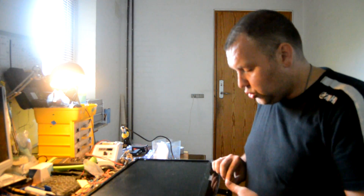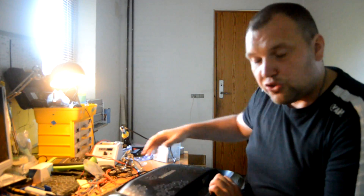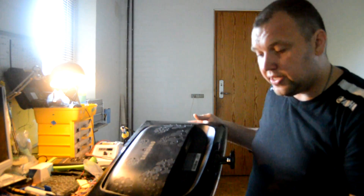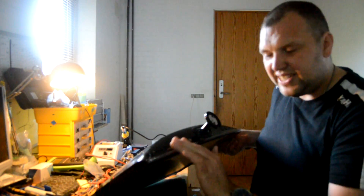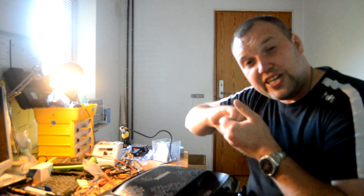I've got the monitor into my work area and I'm ready to disassemble it. The only thing I've done off camera is removing the foot — it had a screw at the bottom you could just take off. It can be quite difficult to disassemble these screens because they don't have any screws on the back — there are one here and one here but that's only for this bezel right there. These are assembled by pressure and you have to sort of wiggle them apart because there are two plastic brackets connecting inside.